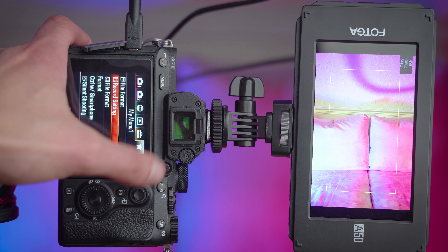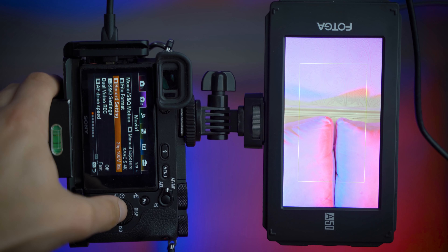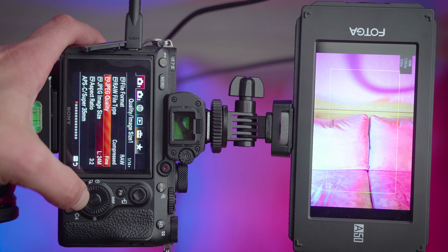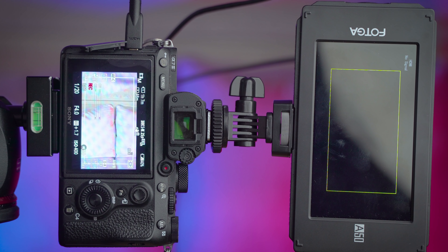The camera also has Wi-Fi, and my usual workaround is to tether my phone to use as an external screen — and that stays active when recording. So that's two streams of 100 megabits a second plus Wi-Fi that the camera handles fine. But it apparently can't handle one stream of 4K — whether at 100 or even 60 megabits — and keep the HDMI port live. It can do 1080 at 100 megabits with HDMI active. Made even stranger by the fact that the A6500, an older camera, does keep the HDMI port live with 4K internal recording.